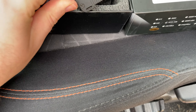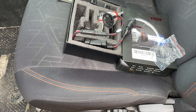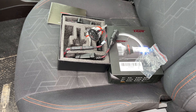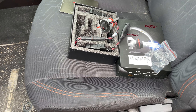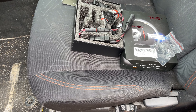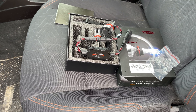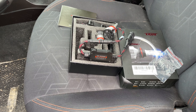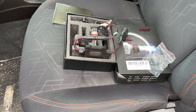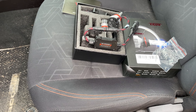What you'll also get is two drivers for the LEDs — these are 36 watt drivers. Your stock fog lights and low beams are about 40 watts and your high beams are maybe 55 watts. Now there are 100 watt versions of these bulbs out there, however you really don't want to run 100 watts through the gauge wire that the Tacoma has, because you have a very good chance of either blowing your fuses constantly or possibly melting some of the insulation on that wire causing a short. At 36 watts this is all that you need — these things are at least five times brighter than stock.